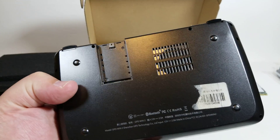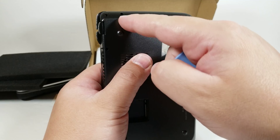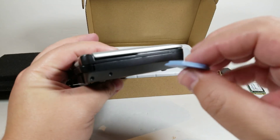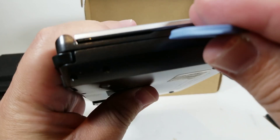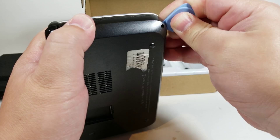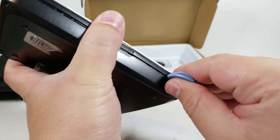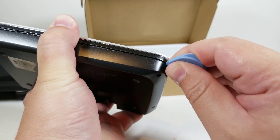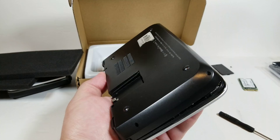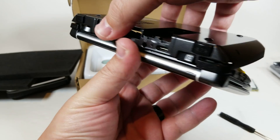So we're going to go ahead and remove those. All right, so I have loosened up all the screws around here. When you try to get them out, not all of them will kind of stay in there. Not all of them will come out. If they don't, just go ahead and take this little plastic spudger tool, a little pick, and you're going to go and find a nice crease that you can enter into, like right there. And what you want to do is you're going to want to go around the rim. You can do this with a fingernail as well, but since you have this tool you might as well use it. It's better to go around the front first before you go to the back. You might have a screw that is still a little too tight, so make sure it's coming out. So this screw is in a little bit more. What you want to do is you're going to want to pull back like this and it comes off nice and easy.